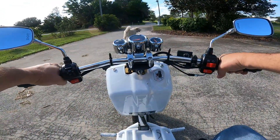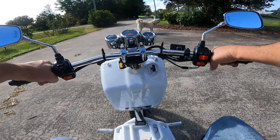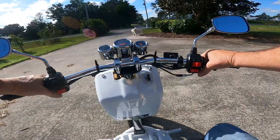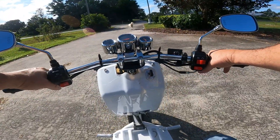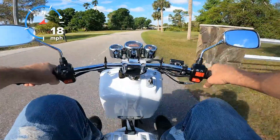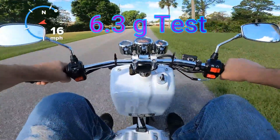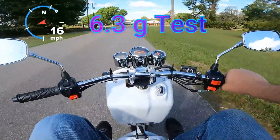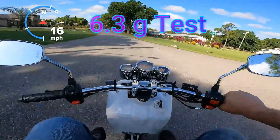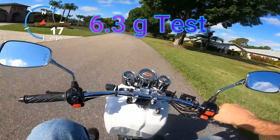These numbers don't mean much to you because your bike might be different, but it just lets you know how much I'm going up. Looks like I'm getting about 1,000 RPM per gram of roller weight — 5 grams were 8,400 RPM, so 6.3g is going to put me at about 7,000 RPM. I probably still like the 5 grams better, but living in Florida, I think I can run some higher weight rollers and get more speed without sacrificing too much down low since it's all flatland.